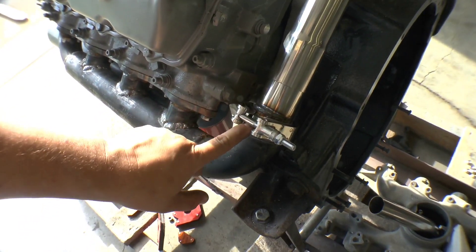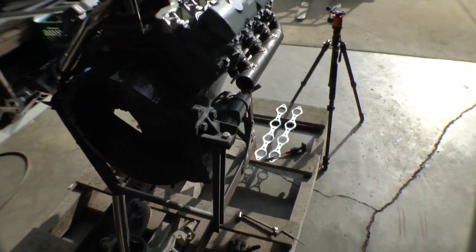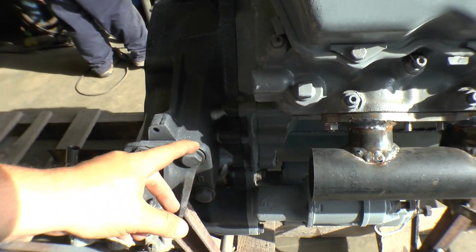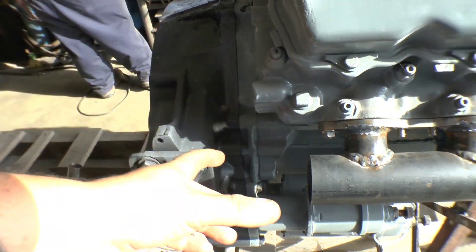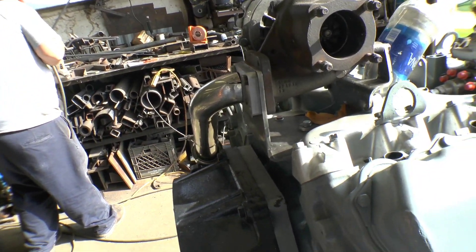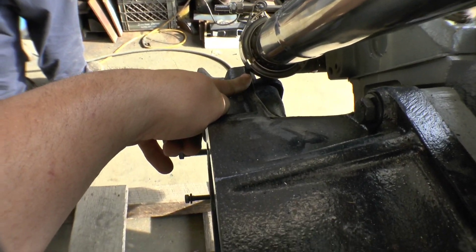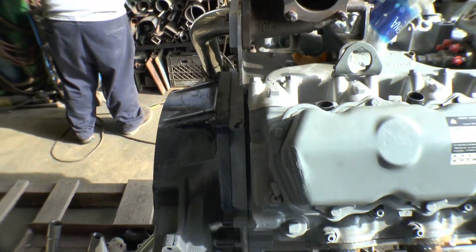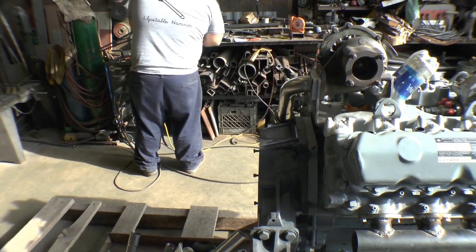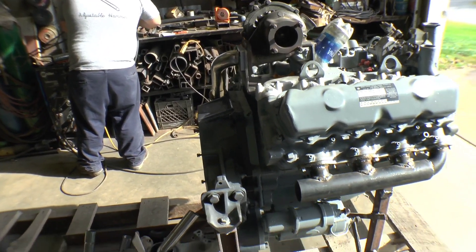I've got my actual V-clamp there and I'm going to do one on the other side. I might probably add a section of pipe and put my 90 and come up through here. This one might have to kick over and up — I'm not sure yet. I barely clear right here; I may knock this down some with the grinder just because I don't really need it, so I can wrap everything without any interference. The rest of it clears, and that should keep me where I don't have to really doghouse the cab too much. I'm sure I'll have to do it some, but I'd really like to not do it any more than I have to.